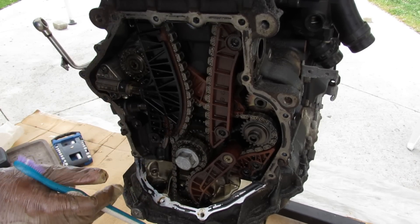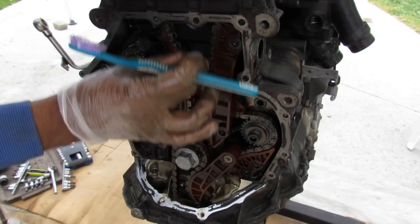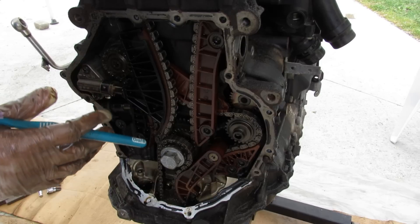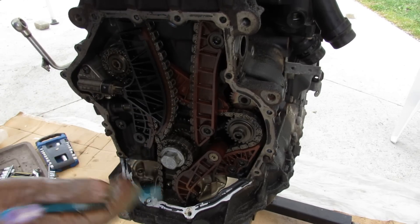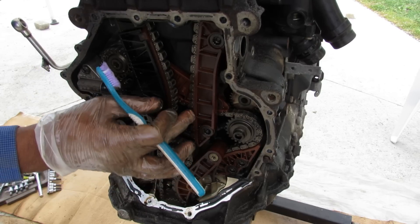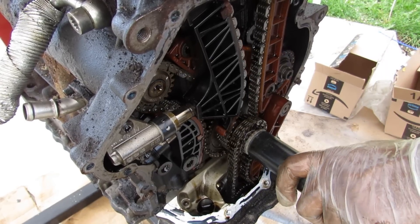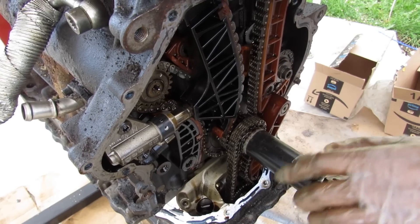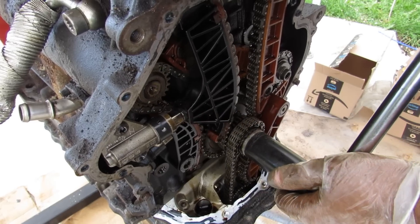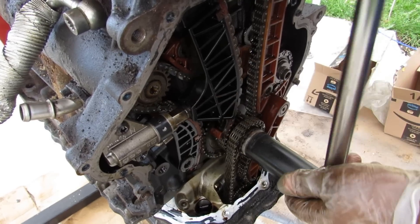Under the lower timing cover we've got the crankshaft, one timing chain going down to feed the oil pump, and another timing chain going up the middle to feed the camshafts. The third timing chain is driven off the crankshaft and spins two balance shafts. So this engine actually has three different timing chains, each with its own guide and tensioner. The main tensioner keeps tension on the chain for the camshafts at the top. If you rotate it clockwise it sometimes locks up; counterclockwise, this tensioner can no longer hold tension against the timing chain guide and just keeps ratcheting back and forth.